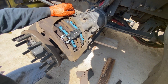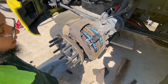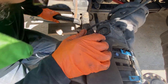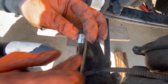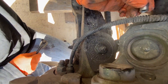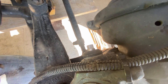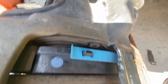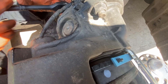You've still got a little bit of play, but you just go back over there with the ratchet — the 10mm socket — and just tighten it up a little bit. That's it. We're going to put a new nut that locks the brake shoes in place, because we have new ones that come with the set. Go over here, put it on with the 10mm socket, and just tighten it. You don't have to tighten it too much — if you tighten it too much, remember, you're going to break this. You can see how it's moving — just snug it up.